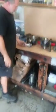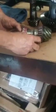So what we have here is a pinion with the outbound bearing and the internal bearing right behind the head of the pinion. All right, this sits inside the unit, the throat of the differential. This is a crush sleeve. This is a mechanically crushed, this is a used one. You can't see a whole lot of difference between the two. If you and I held them up here, we have to actually mic it.